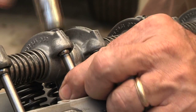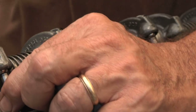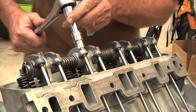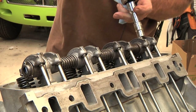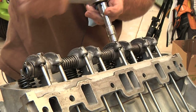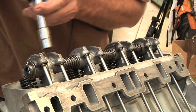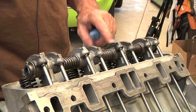We're going to get some resistance because we're actually pushing down some valves. Take this tower bolt down nice and slow. Everything's looking good. The last phase of this is we torque these guys down to about 25 pounds.